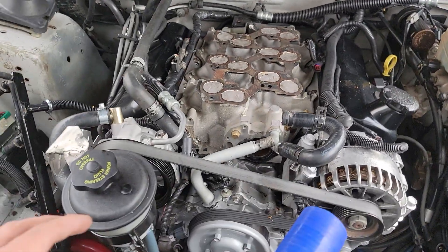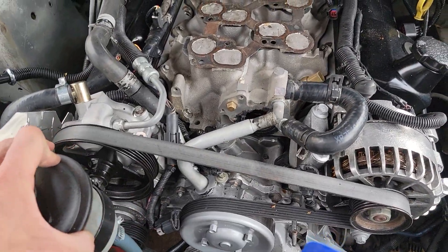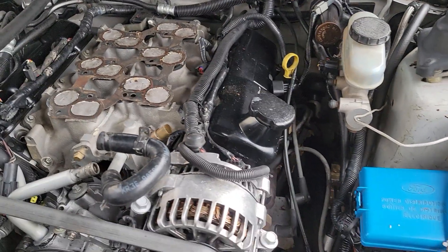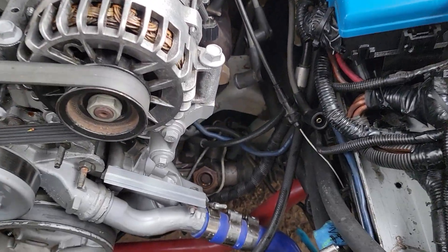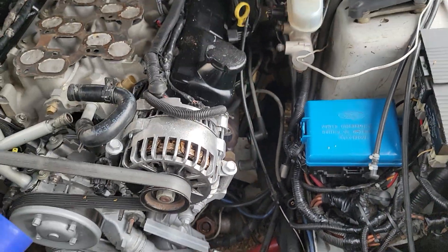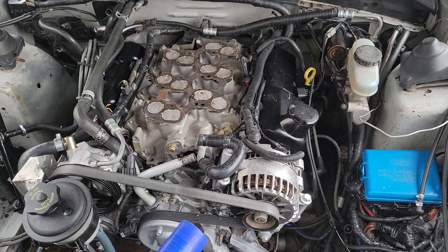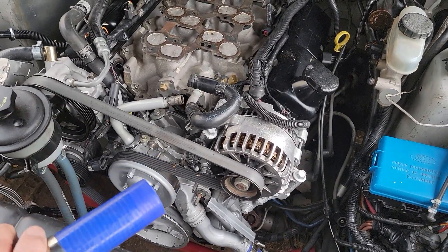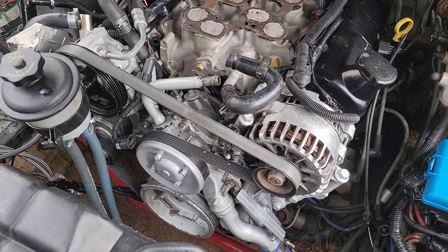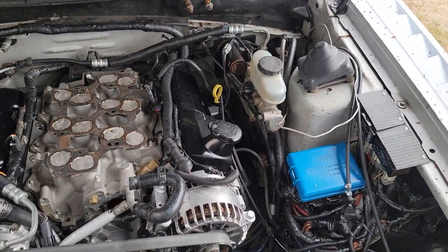It's really nice especially with this smaller pulley. With the Freestar one it was kind of whining a little bit, but with this 5.5-inch pulley it's really making the Hydro Booster work well. That all plugs in plug-and-play. I do have a custom line on this from before I figured that out, but once I realized that with just our V6s the Hydro Booster is 100% plug-and-play swap, I'm glad I could give a final update on my solution to the power steering whine. I've completely swapped to different accessories and it's working great, as well as completing the Hydro Booster swap — just a full upgrade.